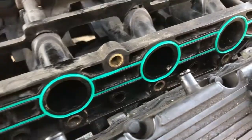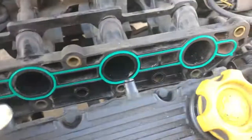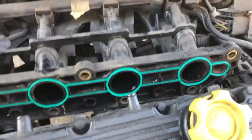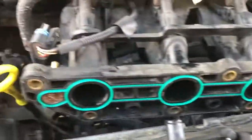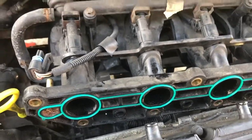You have to push it in, make sure it's all pushed in a little bit. Obviously these bits protrude a little because that sandwiches into the other side. Now I've got to carefully sandwich them together, hold it on, put the nuts on, and tighten it up to 8 Newton meters. So slowly getting there, guys.